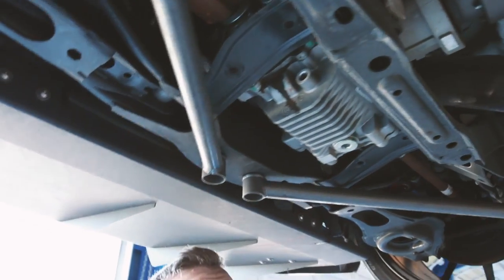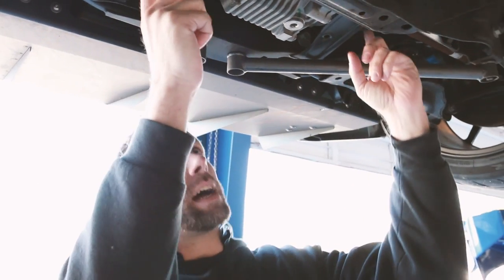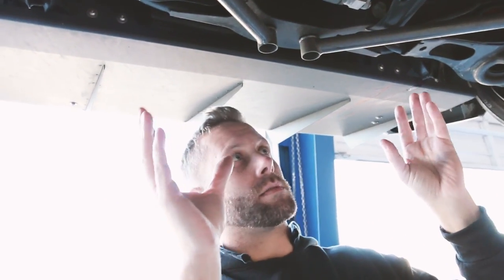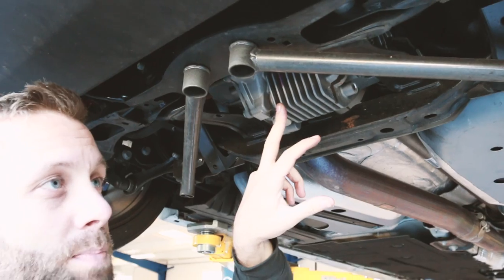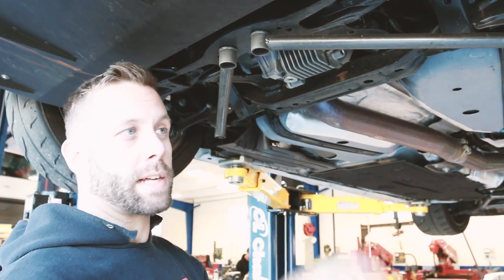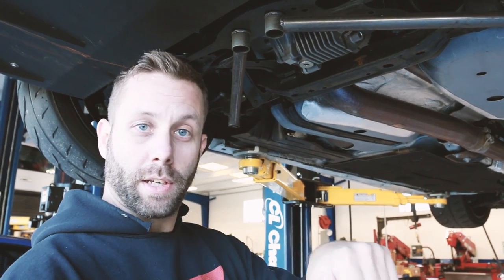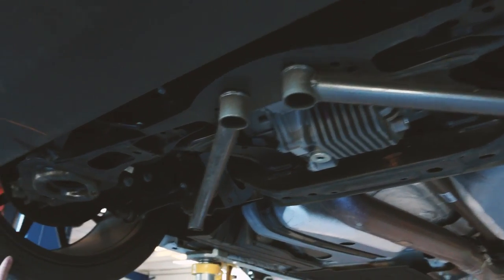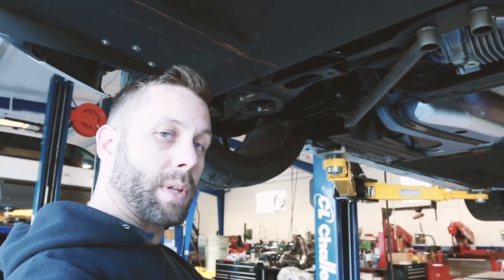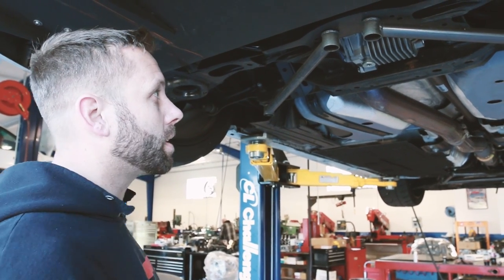What's pretty crazy about this is it's basically like a spool inside — it's not really like a differential; it doesn't have spider gears or any of that. On each side where the axle connects, there are clutch packs, and that's how it engages left and right side torque vectoring. The front and rear drive ratios are different — at full lockup it's spinning just under 2% faster. So in drift mode, if you're turning and you mash the gas, it directs more torque to the outside wheel, which creates yaw, and once the car sees yaw it keeps pushing power around to maintain the drift.